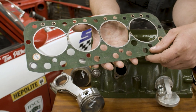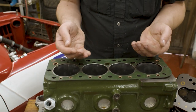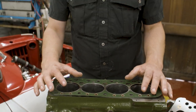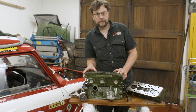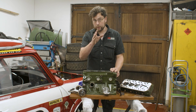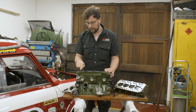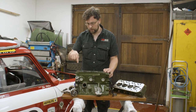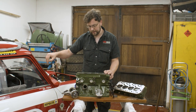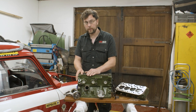The gasket was fitted to the engine with this side down to the block and this side up to the cylinder head. When I looked at this, I got the idea that one of a couple of things was happening. The first failure out at the racetrack — where we changed the first gasket — was across here between cylinder 4 and the outside of the engine block. Immediately I started to think we had a problem with the surface finish of the engine block.